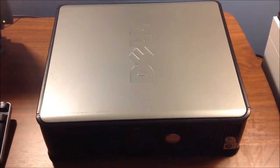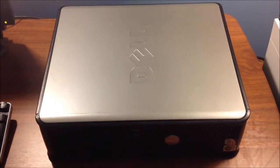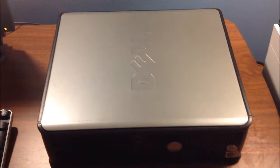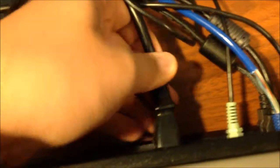This is Dell 3524 here and we're going to be doing a processor upgrade in the Dell OptiPlex 745. The first thing you want to do is go to the back and unplug the power cord, which is right here. That's all you need to do so you won't get shocked in the process.